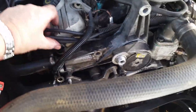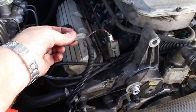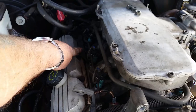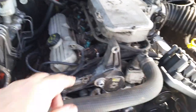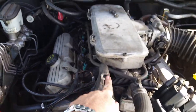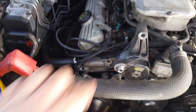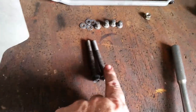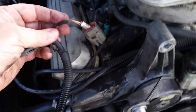Remember where the wires sit too once you get the alternator off. You've got to undo this bar here — it runs from here to the alternator — then undo this one and this one. Just take that bar off and undo the two bolts, which I believe is a 14mm. You can also check your wiring while you're in there.